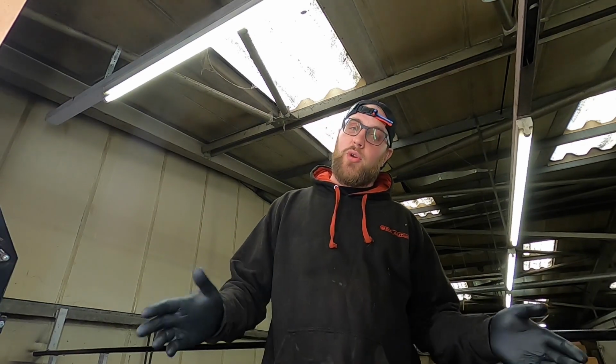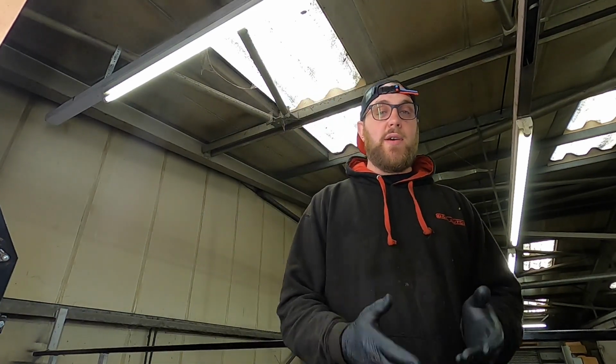In today's video we're going to be doing something a little bit different. I'm going to show you how to Cerakote an exhaust manifold. And if you don't know what Cerakote is, it's a ceramic coating. Basically you spray it on the outside of the manifold and it helps keep temperatures inside, therefore lowering underbonnet temperatures. Obviously the more you do under the bonnet, the cooler it's basically going to be. You want to do anything that radiates temperature.